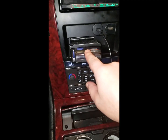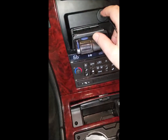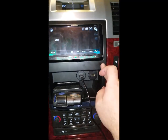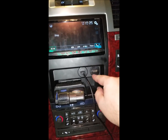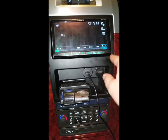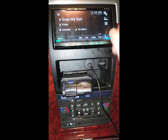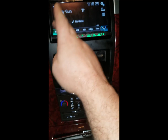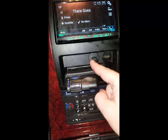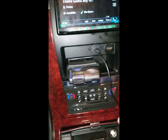This is the brake controller. Got that hooked up in there for pulling the trailer. This runs into the back. I added these little connections here to this panel that I bought off of Amazon, and it worked out really good. There's actually markings on the back of this, 4 of them, like little plus signs, and then you can drill. And then I used a Dremel with a sanding attachment to core out the hole that this sits in, and that worked out really well.